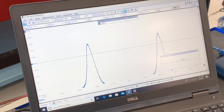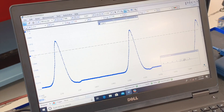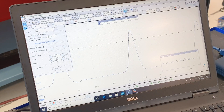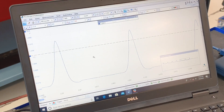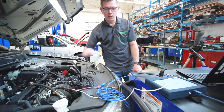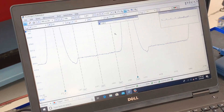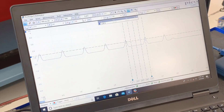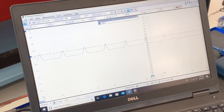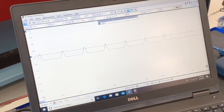So we can tell off the bat, from my experience with the WPS Pico transducer, we're definitely lacking some resolution — you can tell there's a difference. But once I switch this channel to 16 bits to get a little better resolution, we do see some definition in the different parts of the compression stroke process. I've got my WPS transducer set up on cylinder one and cylinder three still with our homemade one. I'll change the channel, add the WPS on range one, go to a 200 psi scale, take the rotational wrap away, leave the ruler for 100 psi, and we'll go ahead and crank it.